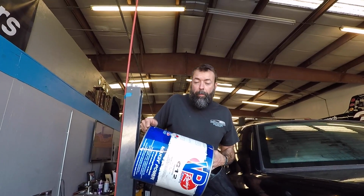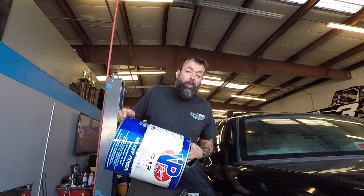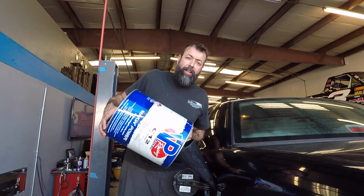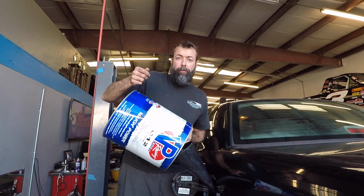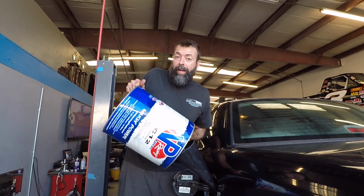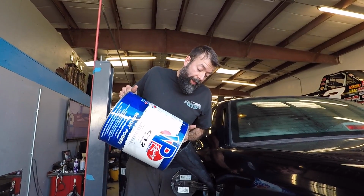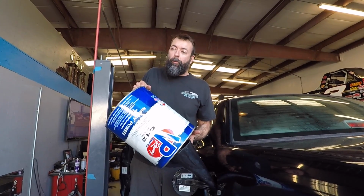You know, we'll do a couple pulls and we'll watch the air fuel change. We're gonna do one just on that change of the Kenne Bell booster pump. So Ford guys, a lot of times, just put the booster pump on there, you crank your fuel volume all the way up, which is a great idea. A lot of GM guys don't do that. I think the GM guys could really learn something from the Ford guys there. Just crank her way the hell up.